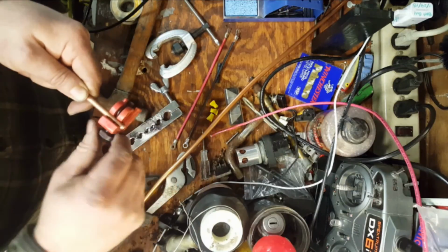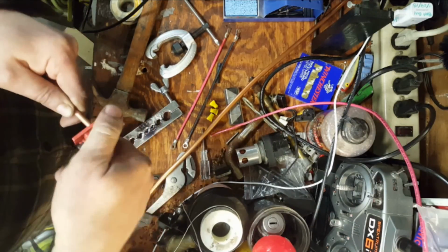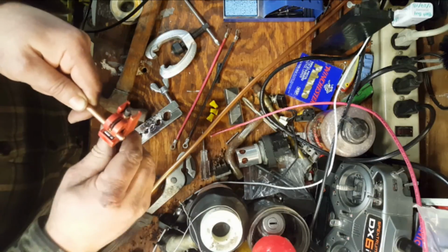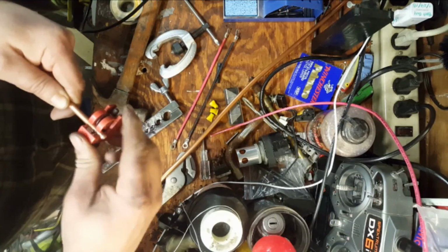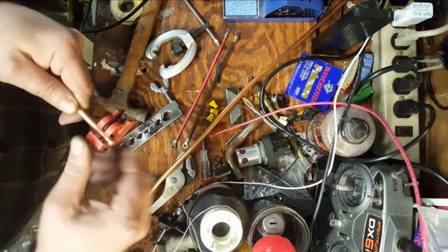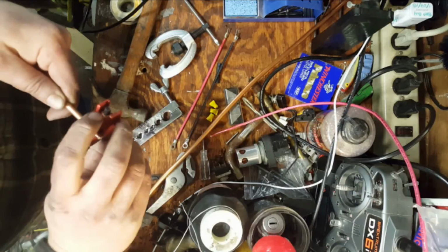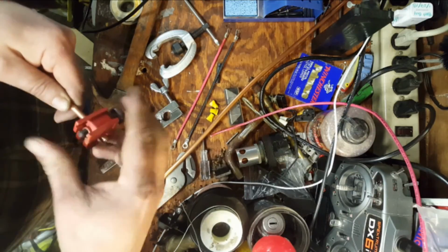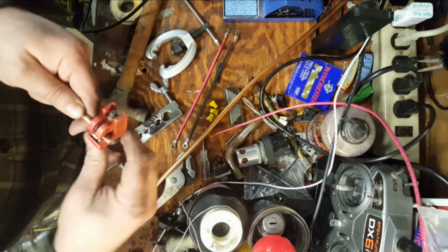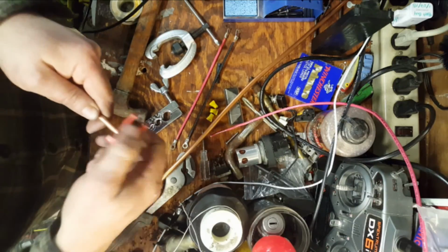You rotate it a couple times, turn it down a little bit tighter so the blade keeps going deeper. Won't take much. Be through this in no time. It's a bit thicker walled. This is a low profile cutter. You use it for tight places, especially on the vehicle where you have very little clearance of already installed lines. I have a bigger cutter somewhere that's a little bit easier to handle, but it doesn't matter. There we go.